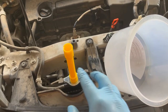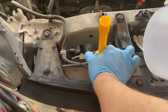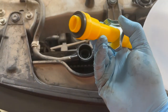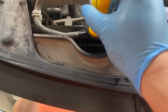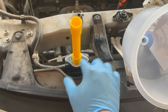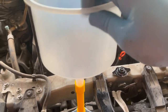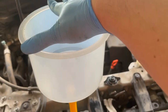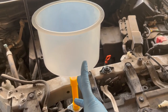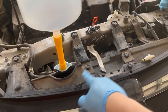The way this funnel system works is you'll have a series of adapters and different connectors. The funnel parts have different adapters that fit down into the radiator neck — you compress them down to make a tight connection. Then you fill the radiator with coolant, place a little coolant on top, and burp the system by leaving the car on for about 15 to 30 minutes so any air gets out of the radiator system.